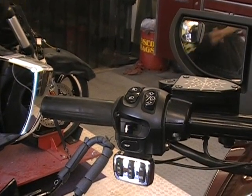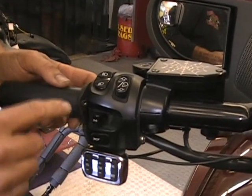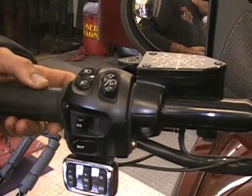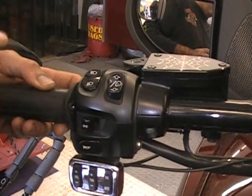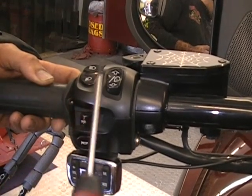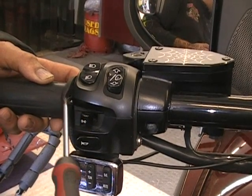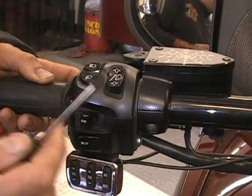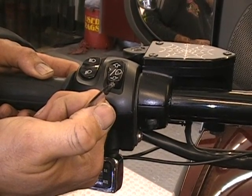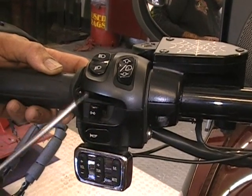Now again, something that I have kind of set up here, but the grips, most bikes, guys cut a razor blade and cut that grip off and take it off or twist it off. On these bikes, you have a little screw down in there. I can't put that screw in because we're not going to use these grips. But it's a Torx head. It's the star head. It's not an Allen and it's not a Phillips. This size happens to be a T15 is what they call it.